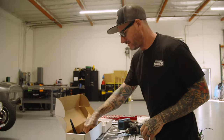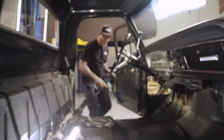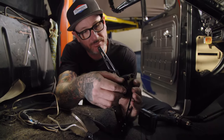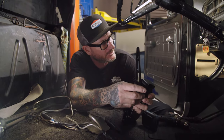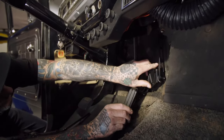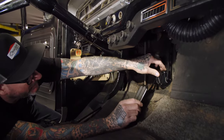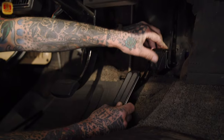I need something to go through here to mark it. The cool thing about this pedal — one, it's really nice, but you can adjust this. If you don't have enough throw on it, you can bring it back, bring this lever forward or backward — it just all depends on where you need it. We need to find a good location for it, and we also have to remember we're working with stuff up here. Right here is where the tunnel kicks out and we don't want that on the tunnel area. Something like that would look pretty good.